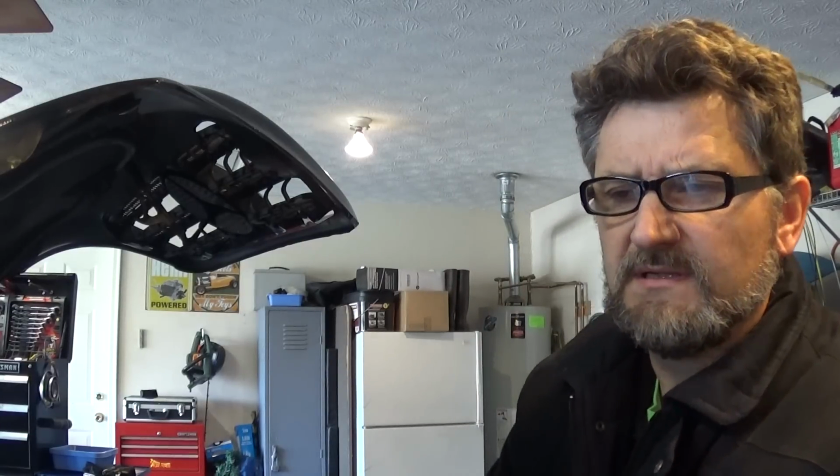Also we can take the car for a test drive, because we have freeze frame data to compare the reading on the MAP sensor. I forgot what it is, but we can go back to our freeze frame and see it again, and then take the car for a test drive and see if that improves or not. Now, all these numbers don't really mean much to me, because I'm not sure what numbers the computer is looking to be happy with, but it gives me some direction to see if I improve anything or not. All right, let's take this apart and see what we find.